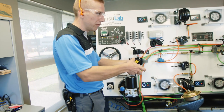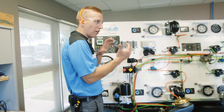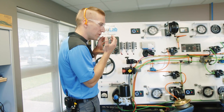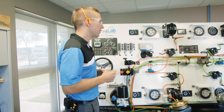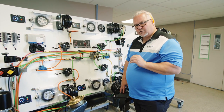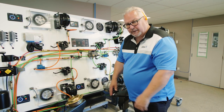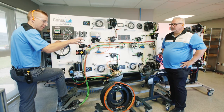But the ABS is now removing just a bit of brake pressure, applying a little more brake pressure — throttling that brake, if you will — to slow us down without locking that wheel. This is a very excellent video for your students to see pedagogically, that they get a visual of what's happening within the brake system. Now we've got disc brakes. Can you talk to us a little bit about that?